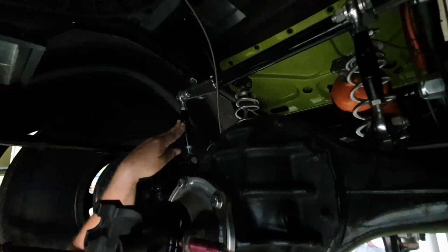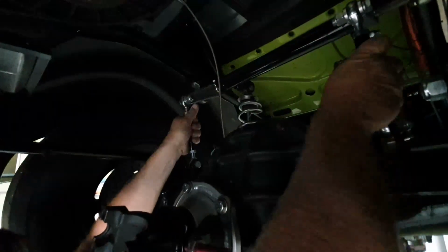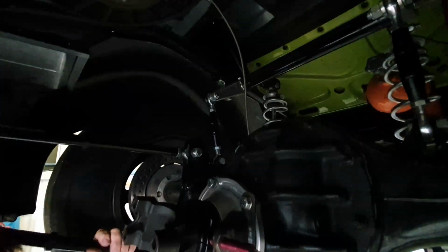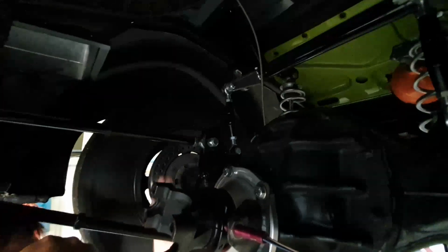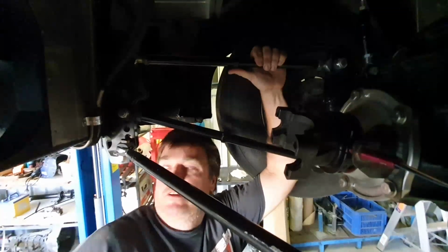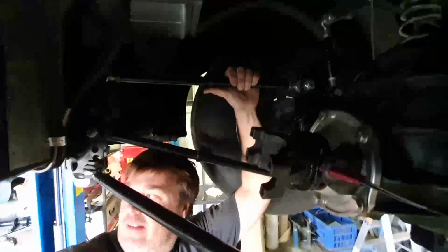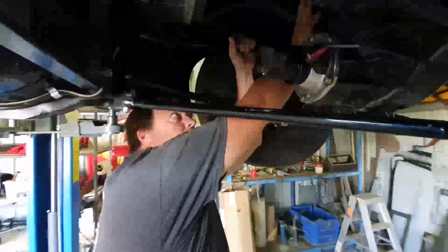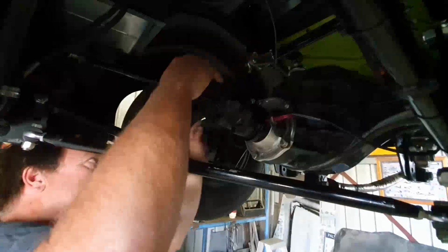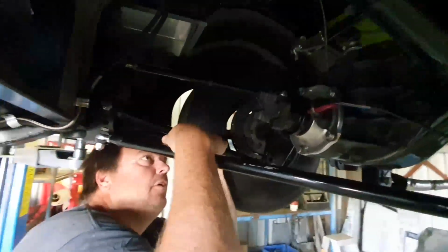The first is the anti-roll bar, and we run that pretty neutral. We don't have any load on it, but how that works is it keeps the diff square in the back of the car. If you see some cars that don't have an anti-roll bar, you'll find this wheel will tuck right up into the guard and it will hike the left-hand front of the car. That's the natural inertia of the engine, wanting to pick that left-hand wheel up. What this anti-roll bar does is keep the diff square on the track and stop it from shoving that tyre up into the guard.